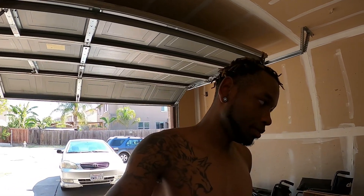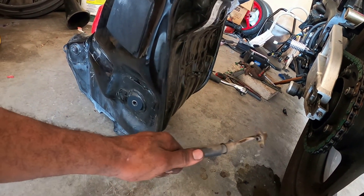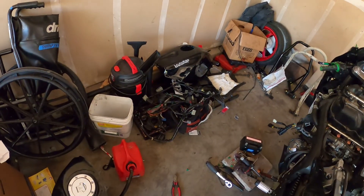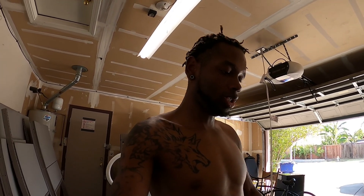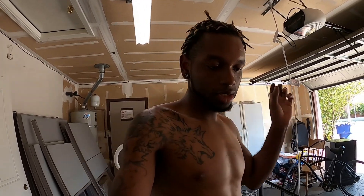So majority of what got fried: like I said in that last video where I fried my fuel pump wires, it basically fried the rectifier wires, fuel pump wires, the transmission signal wire, the fuel pressure regulator wire. Anything to do with electrical currents — stator and rectifier wires got fried, transmission wires got fried, fuel pressure regulator wire got fried. Everything else for the bike is taken apart again. I'm going to hit up folks in the 600 community group to see if anybody has a wire harness and can source me the part number for that sensor. Once that's in, put it back together and boom — bike back up and running.